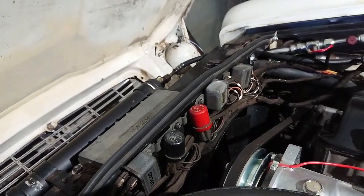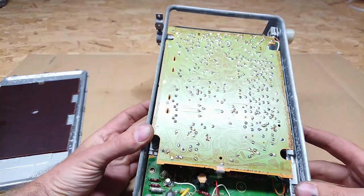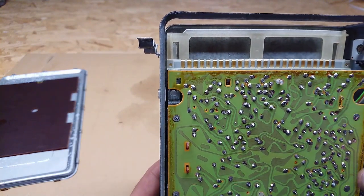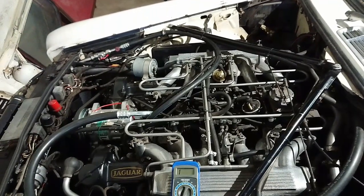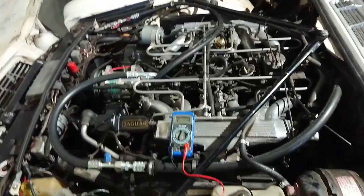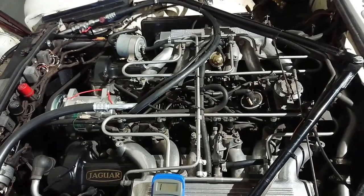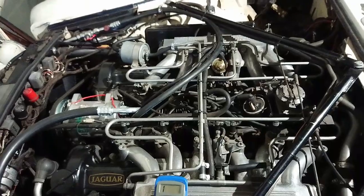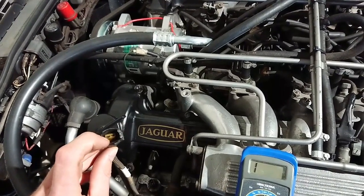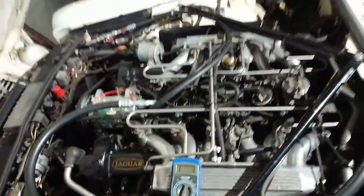Last but not least, there is a large plug at the end of your ECU that comes up from the top — I showed it in a previous video where I took the ECU apart. Make sure that connection is very clean and that the mating surface on the ECU is also clean and not corroded. With all those things checked, if you're still having issues, I would say it's wiring. Disconnect the main end of the ECU, get the pin-out, and check resistance of the cables — there should be little to absolutely no resistance at all.